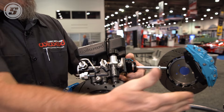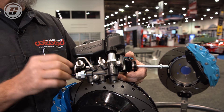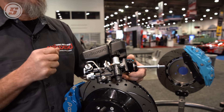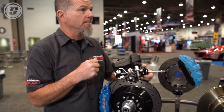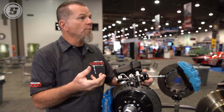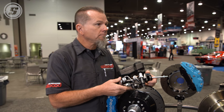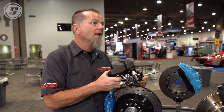When we've got a brake system on a street car, and let's say that you're doing some test panic stops and the rear end locks up — what's happening is we've got too much rear brake in the car. Obviously you don't want that because then the rear end wants to come around and meet the front end.